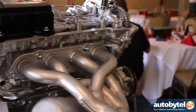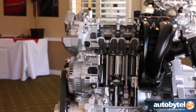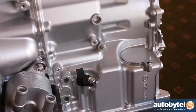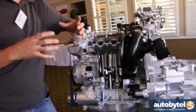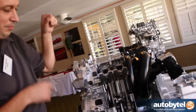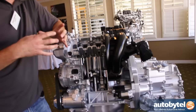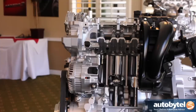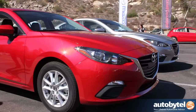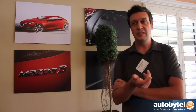Most of the time when you make two different engine families, they'll actually be exactly the same physical size — you just put a bigger bore or longer stroke in the bigger engine. This is the easy way to manufacture using old-school techniques with big machines that do one job at a time. But we build these engines in a very modern factory using CNC machining — a computer-controlled machine that can do multiple machining operations at once. That gives us so much flexibility in design that we're not stuck having the engines be exactly the same size with interchangeable parts. In fact, even though the engines look exactly the same, there are almost no interchangeable parts between them — the 2.5-liter shares only the rocker arms, cam gears, and bolts. We really designed the engine around having the most efficient combustion process. If you change the bore or stroke out of proportion with each other, you'll end up messing up that combustion process. So we got the combustion process we wanted, then scaled everything up proportionally to maintain it at every displacement.